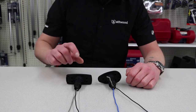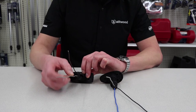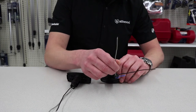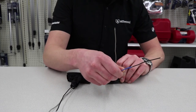The difference between the two pin and the three pin is on the two pin the gray wire is your positive and the black wire is your negative. On the three pin your gray wire is still your positive and the black wire is still your negative, but in addition you have an extra positive blue wire that powers the task light.